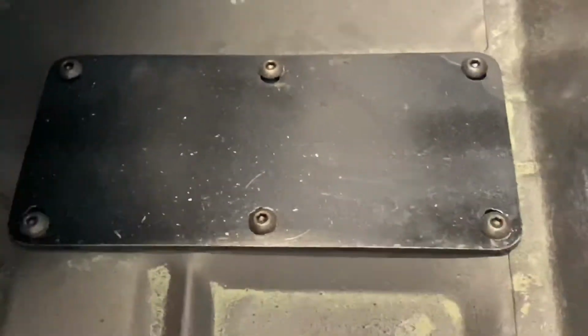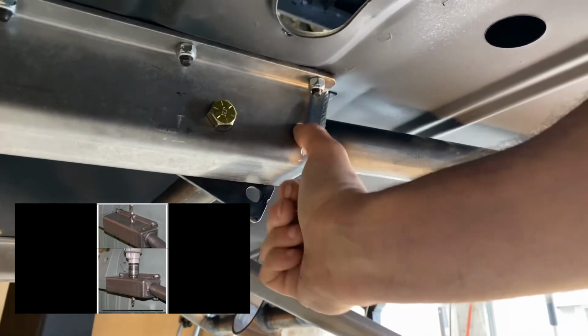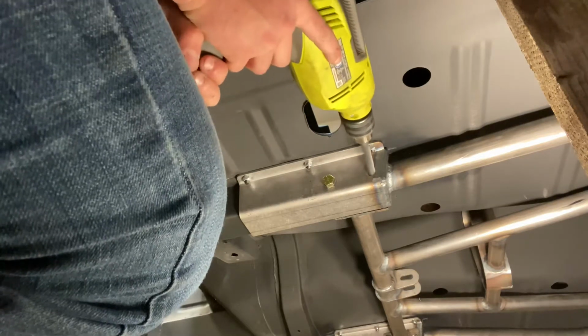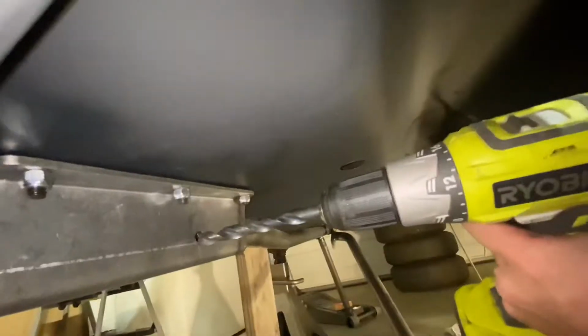Pick 11, seriously, this is important. Start the first set of holes on the outside. Then drill on the inside. Outboard first, inboard second. And drill all 4 bolt holes for the 4 bolts. Don't be a jackass like me and only drill 2 bolt holes, because then you'll be taking off a bunch of stuff later on. Pick 12.